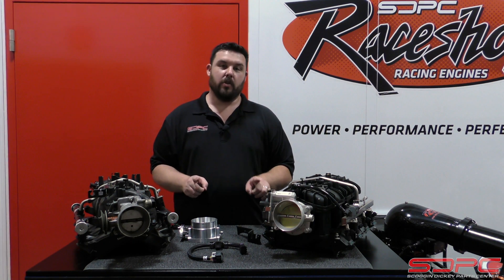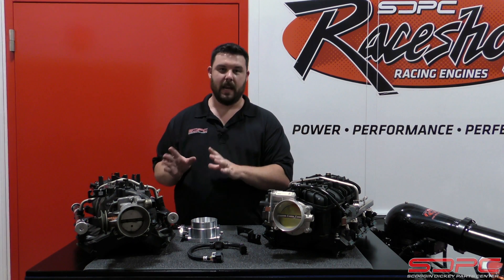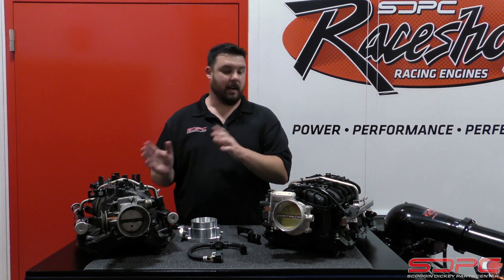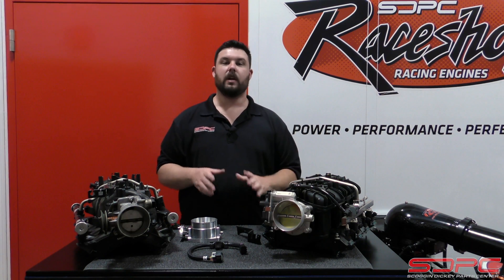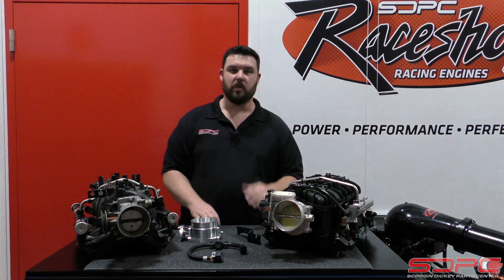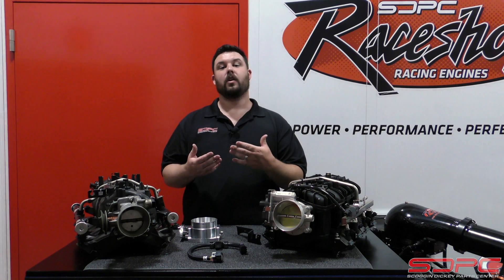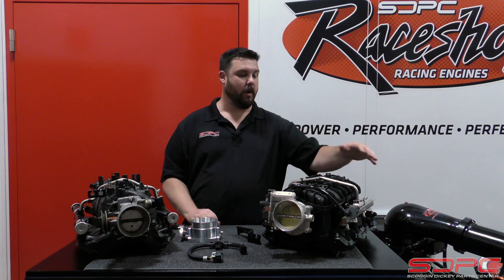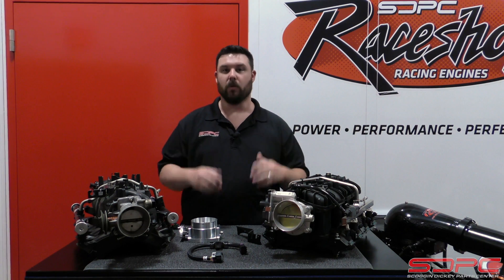What gets complicated is the 99 to 02 Silverado guys. This is an intake that had a return style fuel rail on it, so it had an inlet and a slightly smaller outlet. You unfortunately can't adapt that to the new intake — you have to convert your truck to a returnless style fuel system. This requires a little bit of customization on your part, but it's not bad. It's been well documented online. I've done it myself; it took me an afternoon. Our fuel filter kit is what I used on my truck — the one that has one inlet, a return, and an outlet — so that you can utilize the connection up here without having to mess too much with your fuel tank or fuel pump setup. You just mess with the fuel lines on the frame rail.